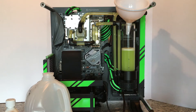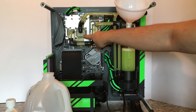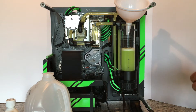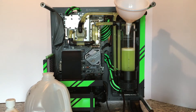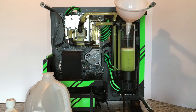If this is good enough, I'm going to let it run. I really do hope that some of this gunk — it looks like a little bit has already cleared — but some of the buildup inside my jet: it's my fault because I didn't clean my radiator first, though it's also possibly because of the pastel coolant I've been using. Pastels have a tendency to build up in certain parts of the loop. I may have to disassemble this monoblock and clean it out, but primarily I'm doing this to flush this specific coolant out of the system and prepare for the new EK beta coolant I've been assigned to test.